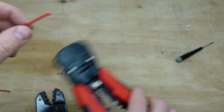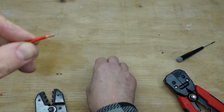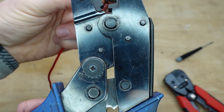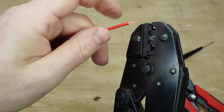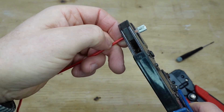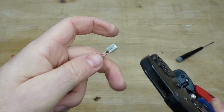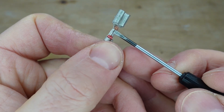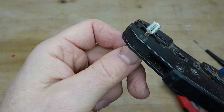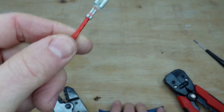The female connector is exactly the same process. Strip the cable, lay it in nicely, and repeat the crimping steps. Pop the copper in — it should just stick through. You don't want it sticking through too far, because you don't want to crimp the outer insulation in the front set of tabs. If you've gone too far back and the front tabs haven't folded over, don't panic — just pull the connector back a little and re-crimp to complete the front crimp.